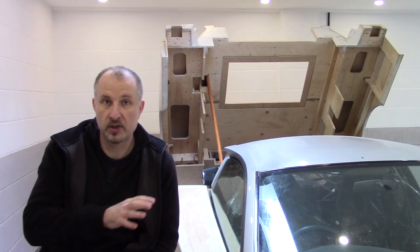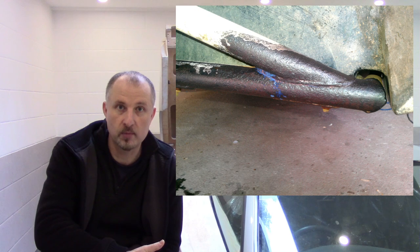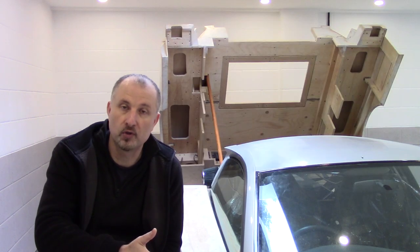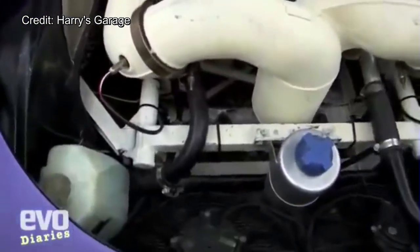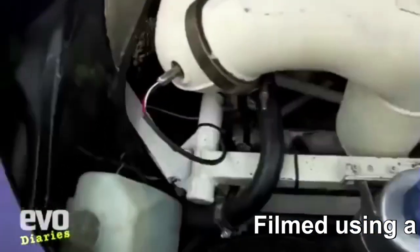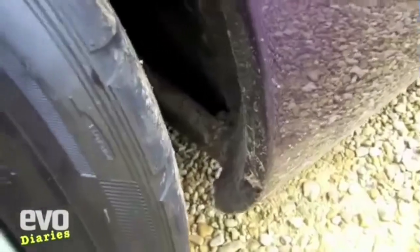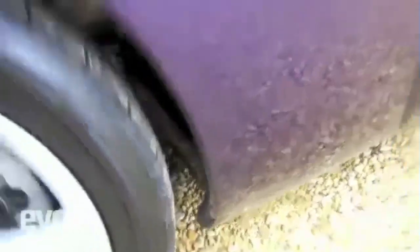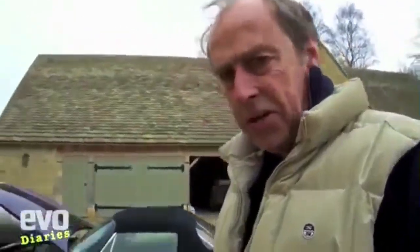A lot of the chassis was exposed under the bodywork and around wheel arches. So once the powder coating had been stripped, you had bare steel and then the outriggers would just rust. The trouble with the TVR - what you've got to look for is potential rust on the chassis. The chassis on these are actually painted white. You can sort of see just the wishbone going off in there. But the critical area on a TVR is here - you can see it. In there, there's that tube. You can just see it in the bottom of the wheel arch, and that tube then runs all the way along the sills - completely unprotected. Look at the rear - it's popping up and going up to the back. Completely unprotected. And that's the bit you've really got to check when you're looking at a TVR.